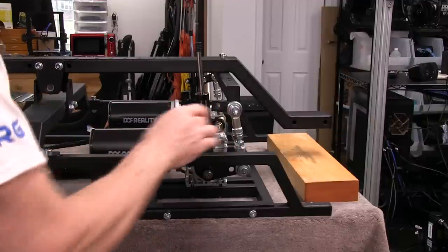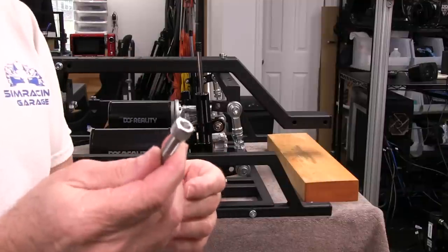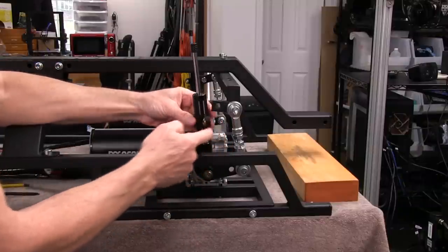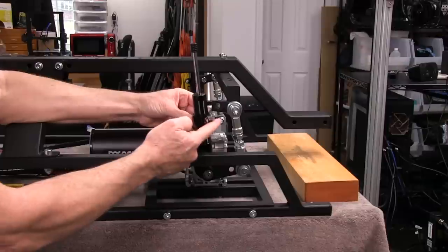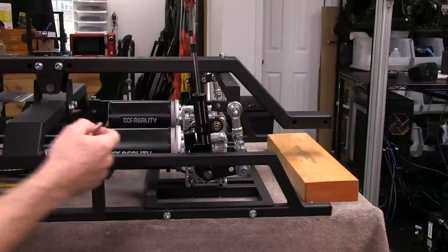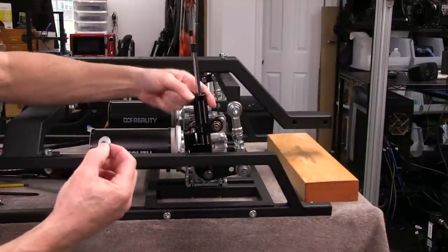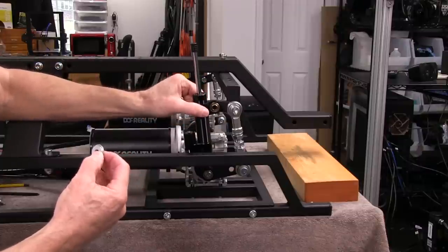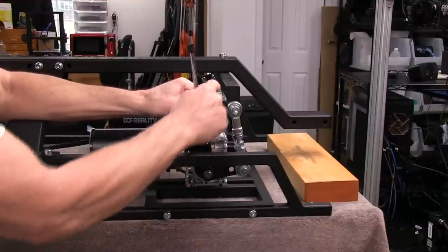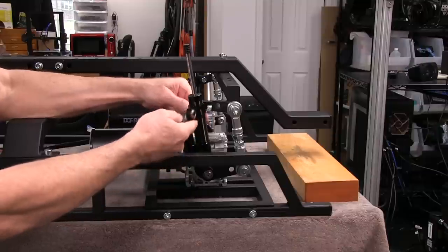But one consideration here, first off, I had to source, they didn't have an M8 bolt that would be long enough to go through that and still attach everything. Because, you know, we've got to compensate for the width of this rod end piece up here. So I got these bolts. But now there's also another issue that we cured by adding a couple of washers on the other side of this bracket. The problem is this, when we run this bolt through here, there's an interference with the curved part of this bracket, okay, on here.